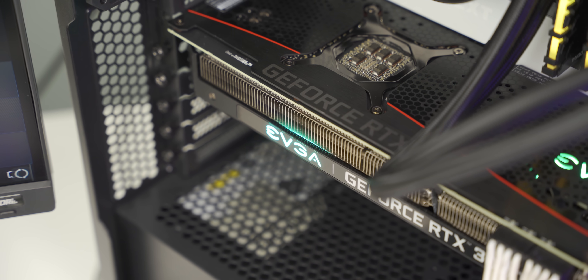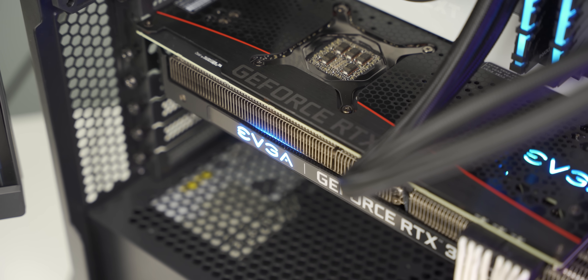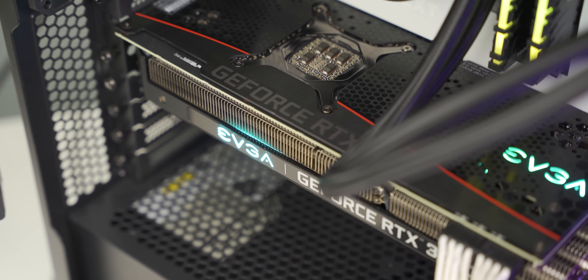Some people do get much bigger temperature improvements going with liquid metal, but I think this small improvement shows that the actual thermal interface isn't the bottleneck when it comes to cooling in this specific RTX 3080. It's got a pretty small cooler on it, so I think the cooler is definitely the issue and not the thermal interface material. The fans are still behaving a little weirdly — I actually ordered all of the correct sizes of thermal pad, so I'm not going to run it like this for any extended period of time. Thank you very much for watching, and thank you Neo for sending over the liquid metal and helping out. Like and subscribe if you enjoyed, and until the next video, bye-bye.